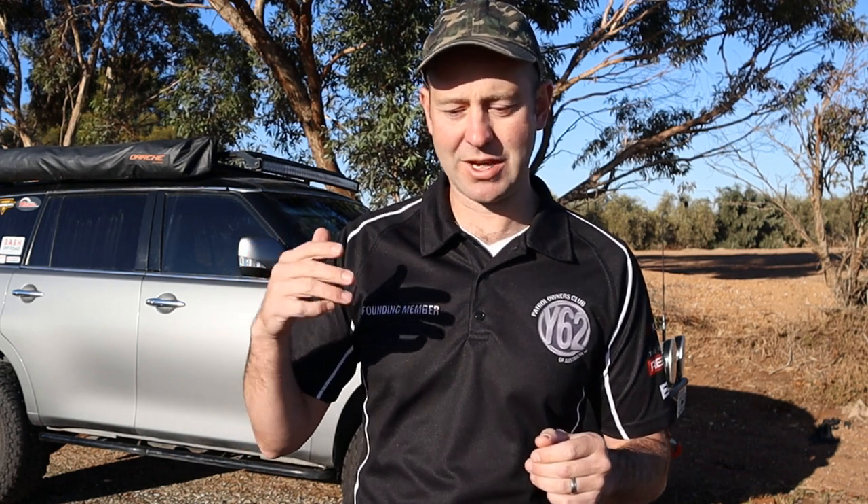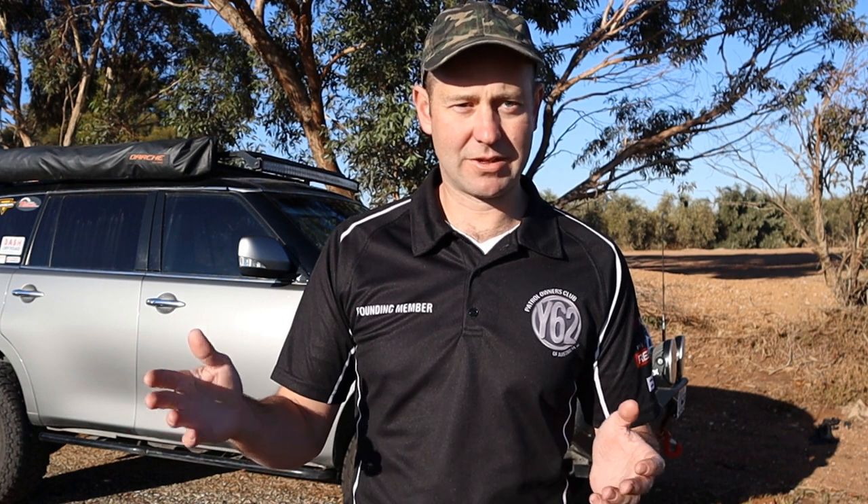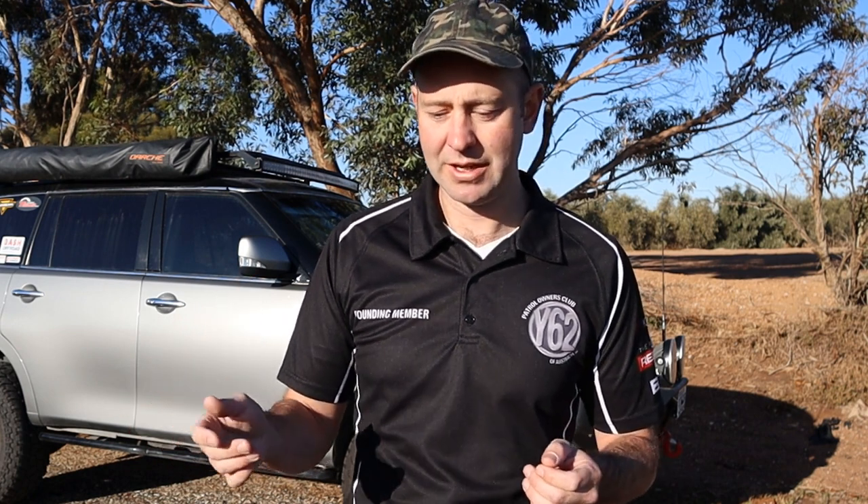When I look back at some of the footage when I was trying to show you guys the drone in my car, the Y62 is really interesting. It must be something to do with the length of the frequency, because in the driver's seat the drone isn't too bad, but in the passenger's seat it's worse. When you get into the back seat and the further back you go, the sound wave must bounce back and get louder somehow. The drone gets really bad, and for the poor kids at the back of the car when we're towing the van and had that muffler delete, it was really bad. Now with this new system, everything's really quiet in the car. As far as cruising with the system — very happy. It only seems to make noise when it's making power, so at idle you can barely hear it, cruising around you can barely hear it. But when you plant it at the lights or you're going up a sand dune or something like that, it sounds excellent.